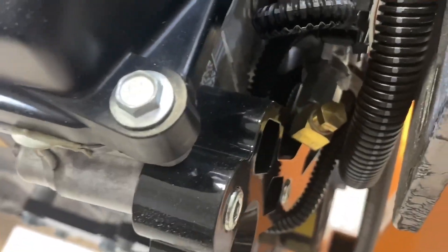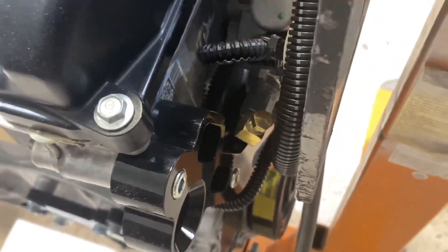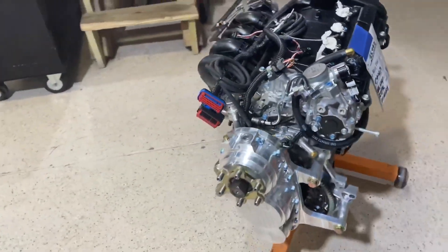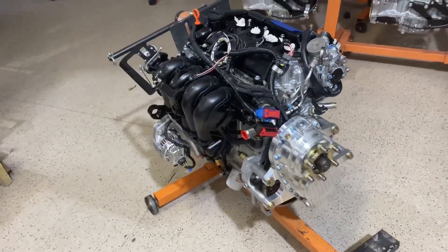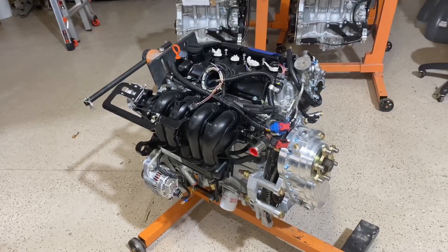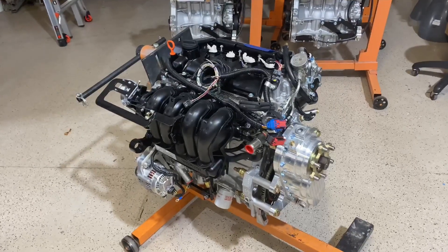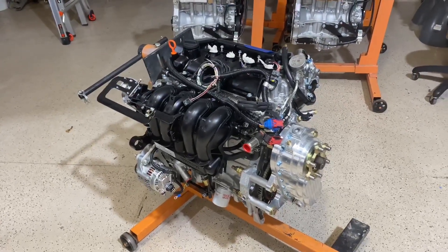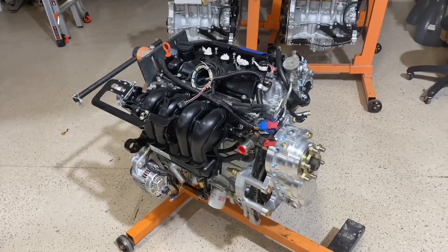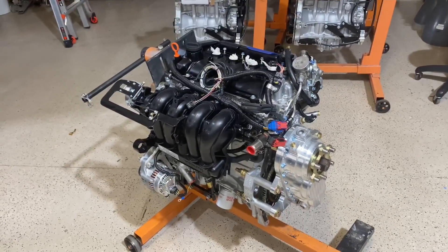Plug your connector in and route it to the instrument. There's another one of these pressure transducers that goes in the back of the airplane — on the Zenith, for instance — and it is for fuel pressure. It goes in that aluminum block where your check valves and so forth are. All the holes in that block lead to the same place, so it doesn't matter which hole you use. Some people even rearrange that block carefully, looking at our diagram, to get fittings and pressure transducers pointed in the proper direction for their installation.